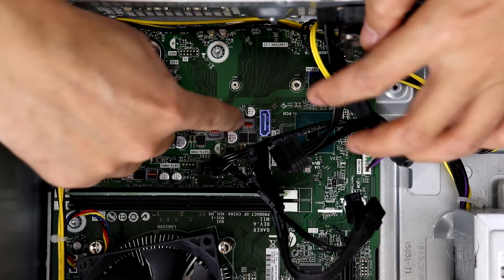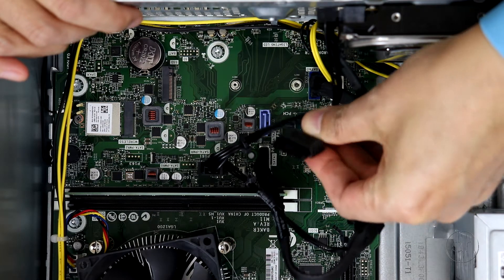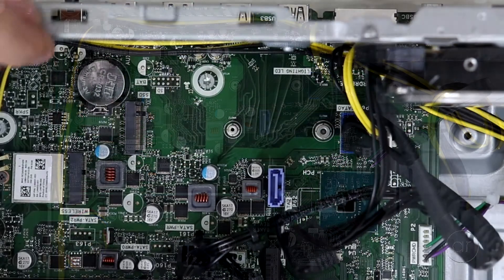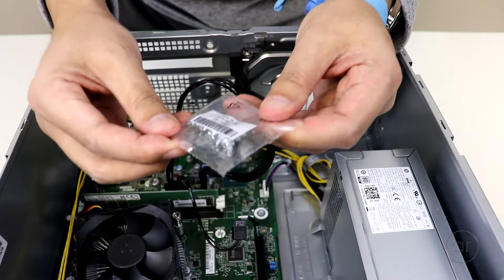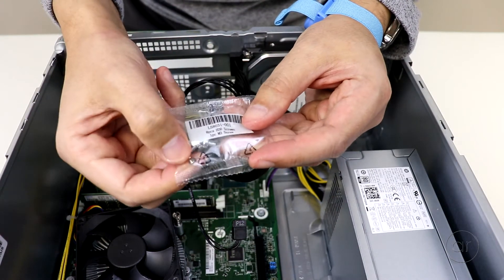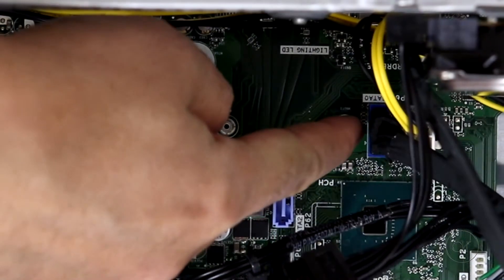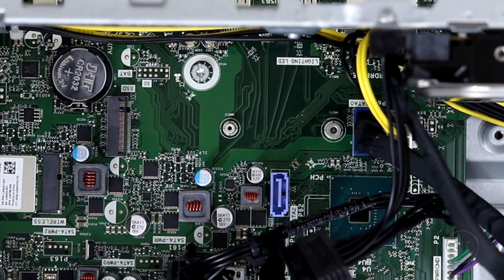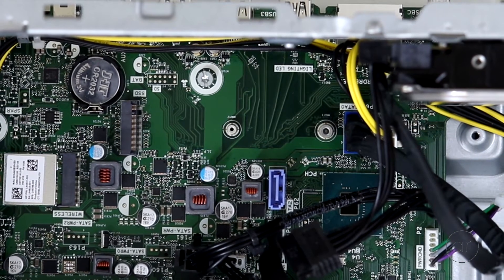Above the memory slots, you'll see a blue SATA port on the motherboard along with a spare SATA power connector, which means you can add an additional hard drive or SSD to the system. The drive itself would go into the silver tray we removed earlier. Next, let's look at the empty M.2 slot. There's space for a 2280-sized M.2 storage device, and if you decide to install one, don't forget the small packet of screws included in the baggie during unboxing, as it includes a screw for the M.2 module. Whether the M.2 slot can take an NVMe isn't clear from HP's documentation, but I'll be installing one soon and will report my findings in the description and/or the pinned comment.